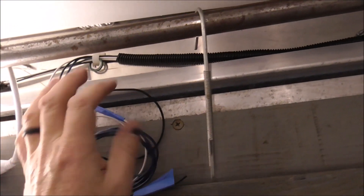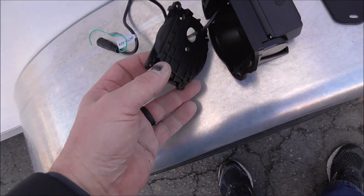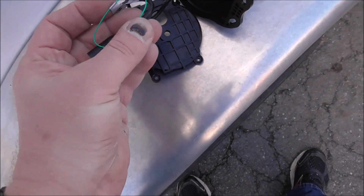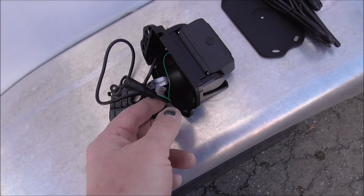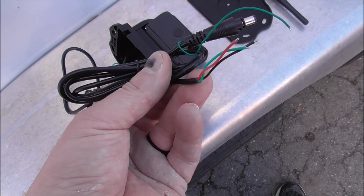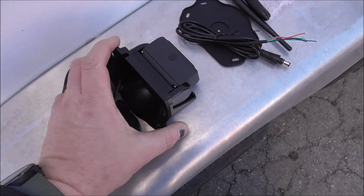In order to put this panel back in place I've got to get this all buttoned up, so we're going to install the backup light and the rear camera. Here's the camera and here's a piece that comes with it. This piece lets you coil up all the slack including the connector, so if you ever have to replace the camera you can take it off and have the connector right there passing through. I've got a nice small grommet that fits the size of this wire.